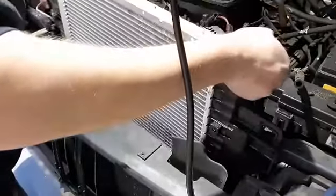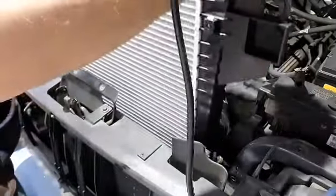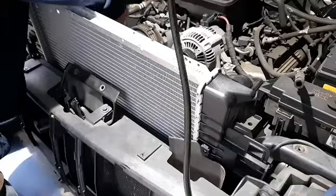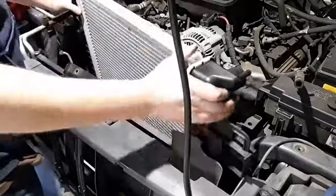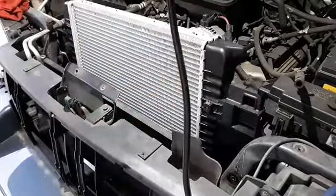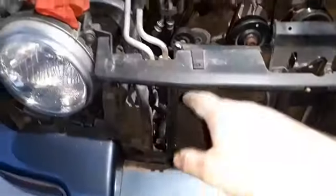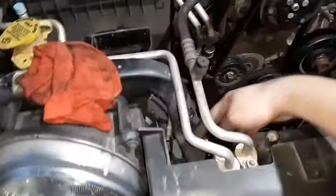There's not really an easy way to get this guy in here - very, very tight. I had to take that radiator back out. It is a hassle to get the condenser moved out of the way just enough to maneuver the radiator. Set it in this way, swinging around under this, and then pop it where it's supposed to go right here.